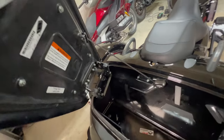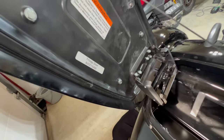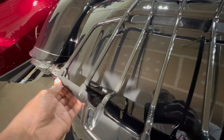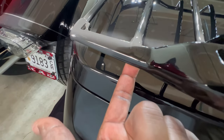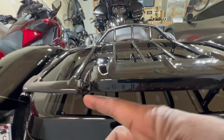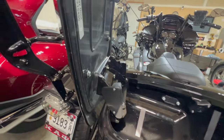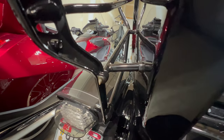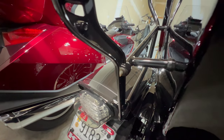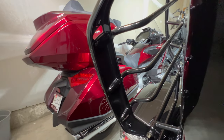What I'm gonna be doing is running the wire straight through this hole here. Once I get that wire ran through, there's a rubber tab under here — under where my finger is right there — that I'll have to pull out. That will allow me to mount the light through that rubber tab, down through the tubing, and out through the hole right there. I wanted to show you the rubber tab and these are the hole mounts I'm gonna be hooking the brake light up to.